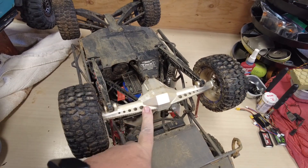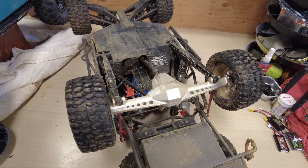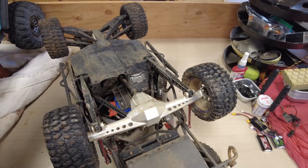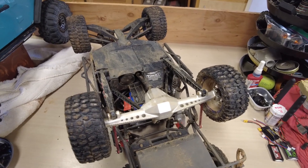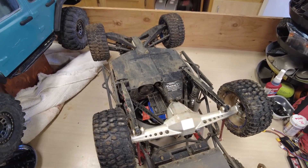So I thought it's time to invest in a rear axle. There are cheaper axles on eBay and Amazon, but they still have the split planetary. When Vitavon does theirs, this is all one piece — the cap goes on here, so the whole thing is captured. You only have a couple points where dirt can get in. They're really good machinists. I tore this apart about two months ago after about a year and a half of running it pretty hard — bone dry all the way through, not one piece of sand or dirt. The grease was fine.